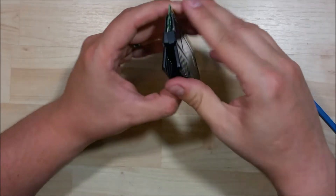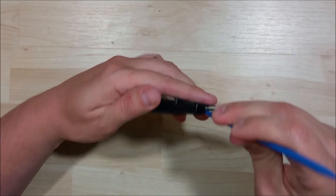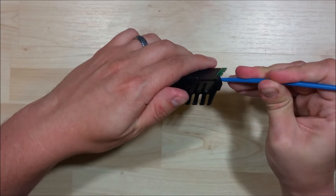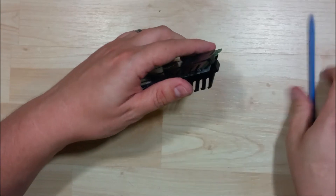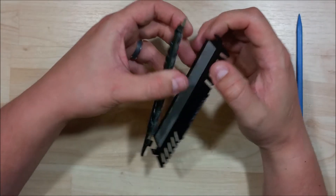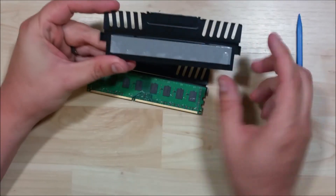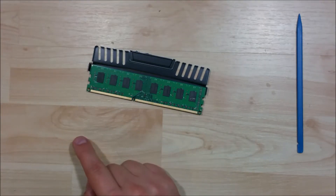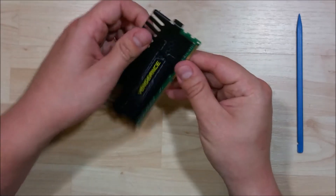I'm being pretty gentle when I'm prying it apart. I'm not saying you can't put a little bit of force into it — they are pretty sturdy items — but I wouldn't say you want to dry rip it off. I'm just going to put it in and wiggle it back and forth. You can see it's starting to pry back, just being gentle to get the glue to release. You can see right here how it was stuck to the chips, and all along the sides here are those little tiny chips you want to be careful of.